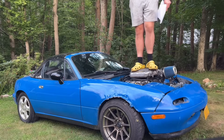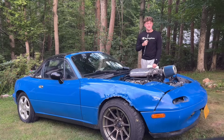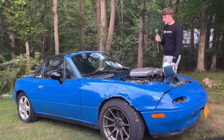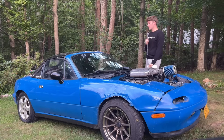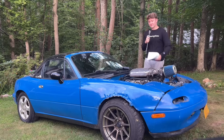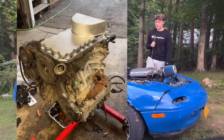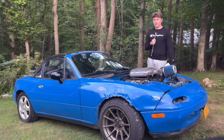Now that the engine was all prepped, it was time to just throw it in the car. And honestly, it was about as easy as dropping in the stock BP. There's still a lot of room, especially with this motor being so high and actually a little shorter than the stock four-cylinder. Another thing I love about the Oz kit is that it utilizes the stock Miata subframe — so you keep the stock front suspension, stock steering geometry — and there are motor mount adapters that utilize stock Miata motor mounts. There's just an adapter that bolts right up to each side of the J-Series block. Keeping the stock subframe is made possible due to the custom oil pan included in the Oz kit. There's an oil pickup tube that bolts up in place of the stock one — Honda bond the oil pan on, and you're good to go.